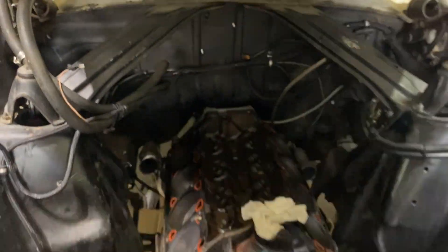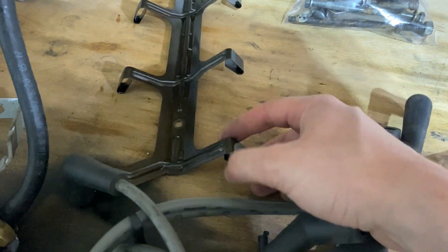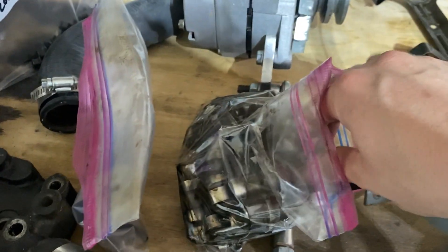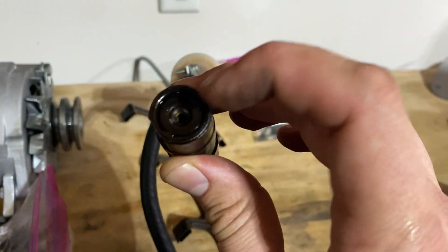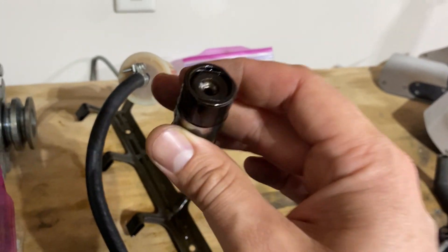But the moment you've all been waiting for - I'm going to pull the cover off and show you what I found. These bolts right here held on a tray - this tray is what holds the little dog bones in place that hold your roller lifters. This right here is a hydraulic roller lifter. Hydraulic meaning it fills up with oil and there's a little plunger in there - that's the hydraulic side. And here is the roller. A flat tappet hydraulic lifter would look similar but this other side would be totally flat - no roller. So this is super cool: it's a hydraulic roller motor.